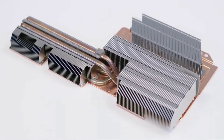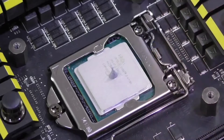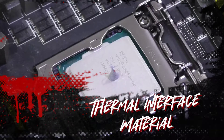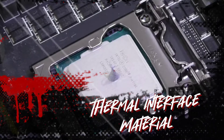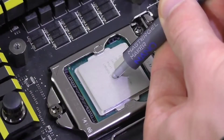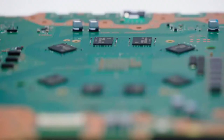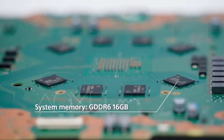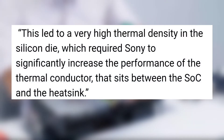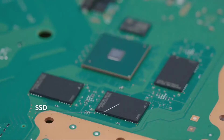To get the most out of that heat routing, you want to ensure there's a strong connection between the chip and the heatsink. That's the job of the thermal interface material, aka TIM. Typically, systems use a paste-style TIM, but that really isn't good enough for the PS5. The PS5's system-on-a-chip is a small die running at a very high clock rate, leading to a very high thermal density in the silicon die, which required Sony to significantly increase the performance of the thermoconductor between the SoC and the heatsink. And because of this, Sony chose to go with liquid metal cooling.